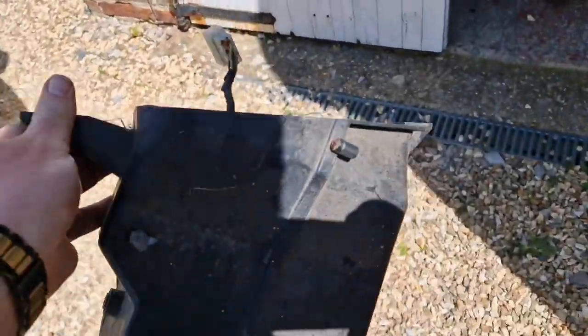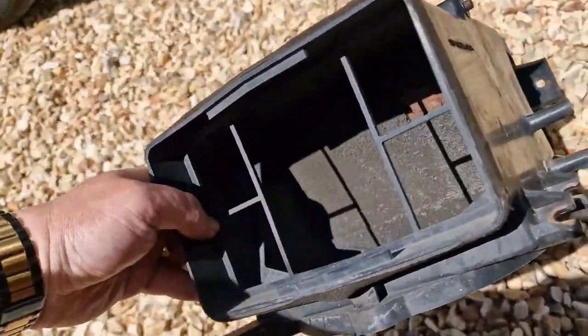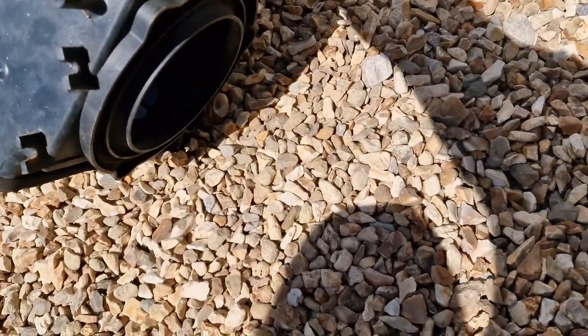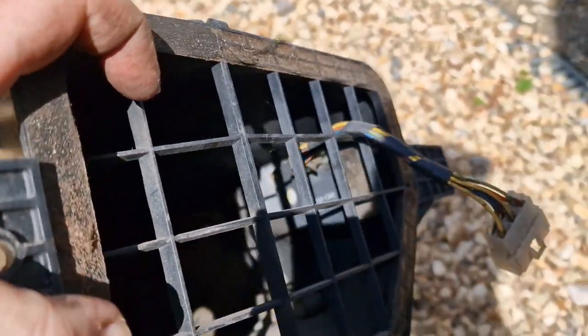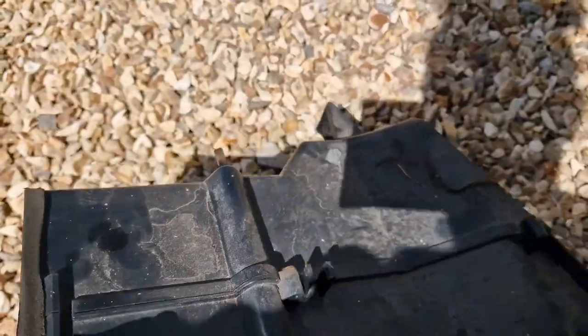This is the recirc box I've taken out — it never worked and I couldn't really be bothered to fix it. There's a little flap that pulls air from either this hole or from the front hole and then puts it down through to the fan in the cab. There's a little servo motor connected to the flap, but that arm thing at the bottom has just snapped off. I might repurpose this motor for something else in the van.